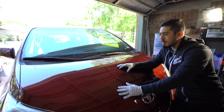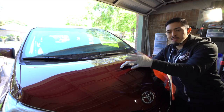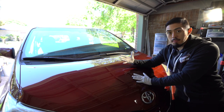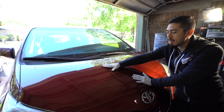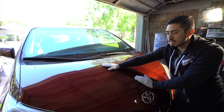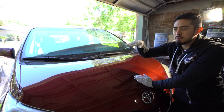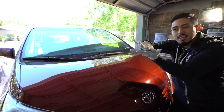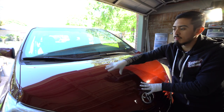When you're working these contour areas, maybe not this, but like on a truck that has little grooves on the hood, or any vehicle that just has some weird contours, it might not work as efficiently because you always have to have the pad completely flat on the surface. You can't have it midway where a quarter of the pad is up and the rest of the pad is down on the surface. It's gonna rotate the most efficiently when it's completely flat on the surface. Once you get one side lifted, you're putting too much pressure onto one side, and that's when it starts to bog down. So you need to have the pad completely flat at all times, no matter what you're working on,